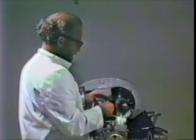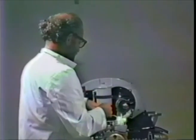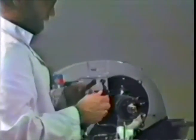While we're here, may as well tie down the generator, put the fan belt on, get out our powder painted generator strap with the CAD plated bolt. Take out the CAD plated bolt. The generator strap should go on such that the bolt goes that away, fans. So you put the strap on like this. Put it in this groove. It helps to do that to start the bolt.